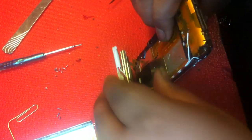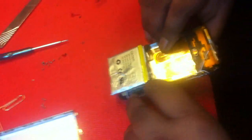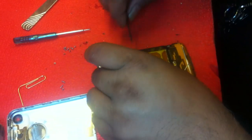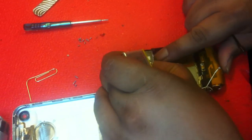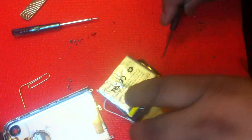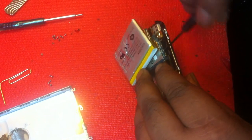I always start off at the right side with the digitizer, then the second one the proximity sensor, and then this one is the LCD cable. You've got three out of the four cables that you have to plug in — done. Then you've got the last one, the LCD. We find a slot and we push it in, just like that, all the way to that line — it has to go all the way to that. If you unlatched it, this is the perfect time to go underneath and latch it now. I skipped that step because I've done enough of these.